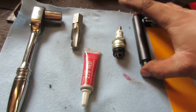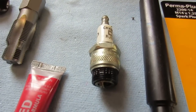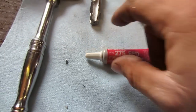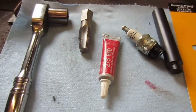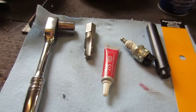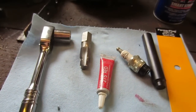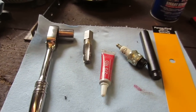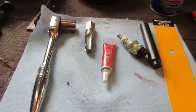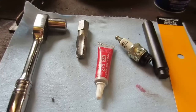You'll have an installation driver, and you'll have your insert — I've already put it on the plug and applied red Loctite. You want to use red Loctite, not blue, not RTV, nothing else. Use red Loctite because it's designed for heat and pressure. This will actually withstand 3000 PSI of pressure, so you shouldn't have a problem if you use the correct item. Do not use anything but red Loctite.